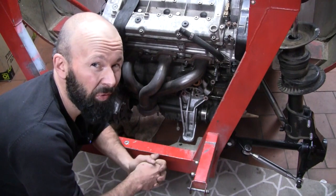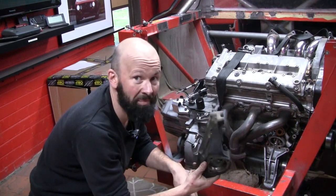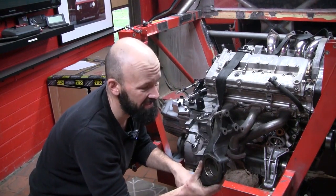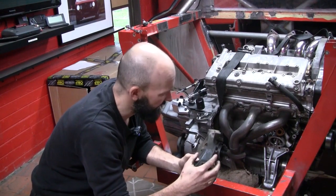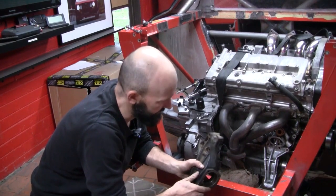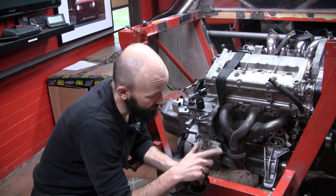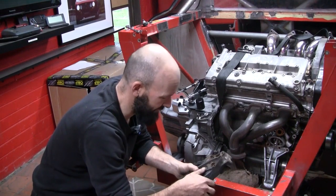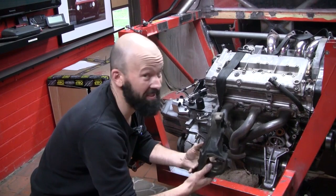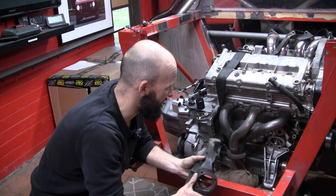So what are our options? We could try and use something like this — an engine mount off an even earlier V6. It's got the bearing housing in the correct location radially, I think, but it's still too far back for that drive shaft. It's also missing all the oil filter and oil thermostat arrangement. Maybe there's a way to jerry-rig something up, but it's also steel and not alloy and weighs a metric ton, so I don't think we'll go down that route.